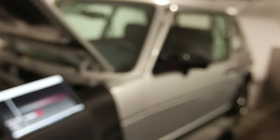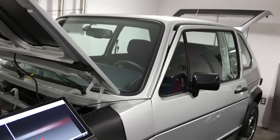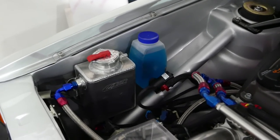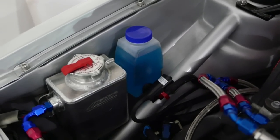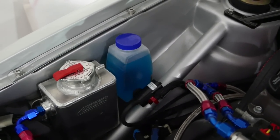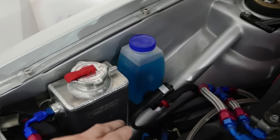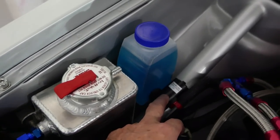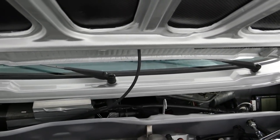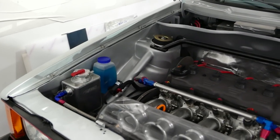All the glass is into the car, and it goes in for its road test in 24 hours — hopefully it'll pass. For the windshield wiper fluid, I built a flange off a mount to attach to the back of what's basically a Tums antacid container holding about a liter. There's a little Mugen pump running through and up to the nozzle. Everything's done; it's going in for its road test tomorrow, and if all goes well it'll be permanently licensed and I can start driving and testing it properly.